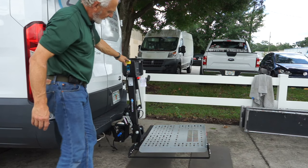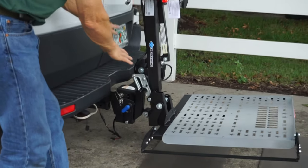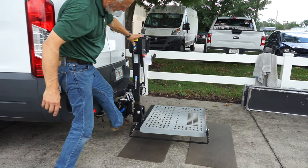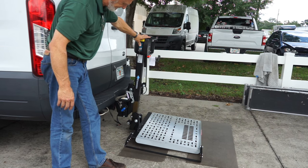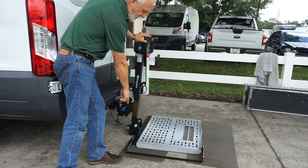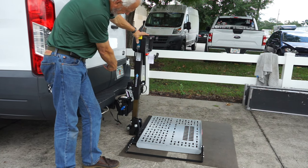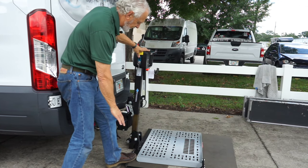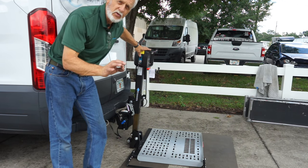As you can see, there's a wheel here where my foot is. When that wheel goes under here, the platform goes under the vehicle and under the lift, and it comes back on properly when you're done. You'll see the wheel, and when you come back up you'll have that tilt back on. Drop the platform like this — as soon as it touches the ground, stop going down. If you keep going down, you're going to raise the truck. We just want the platform all the way to the ground, right there — close enough — and then you would get your scooter on here.